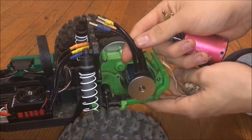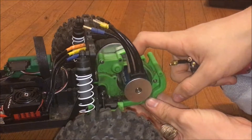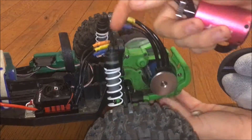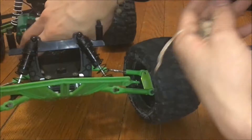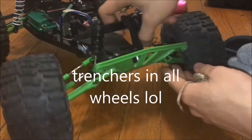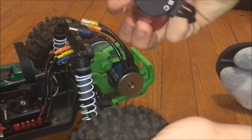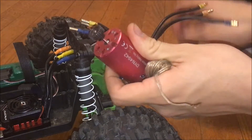Also with this motor I've been going into thermal shutdown a lot, because this motor uses 90 amps and I have a 60 amp ESC. Off-road this thing is just making a lot of heat. As you can see I have like 20s on all four wheels, so that's a lot of weight. This is a lower kV motor, so it will handle the weight and all that better.